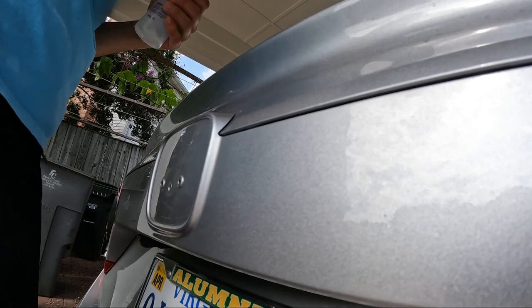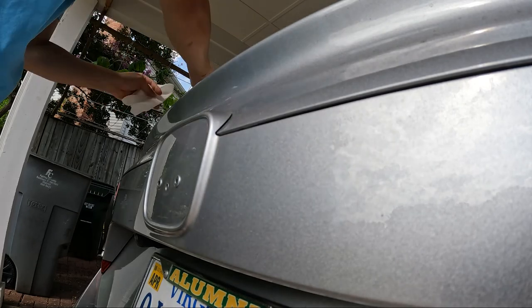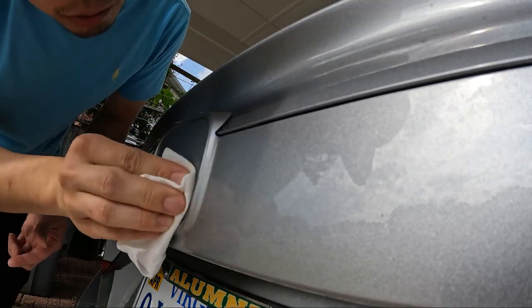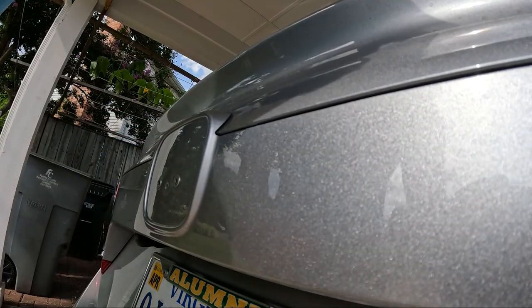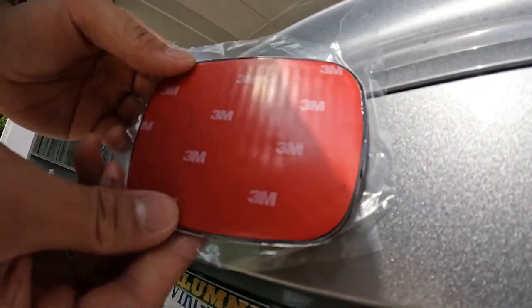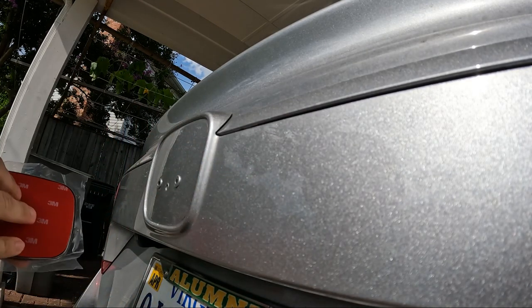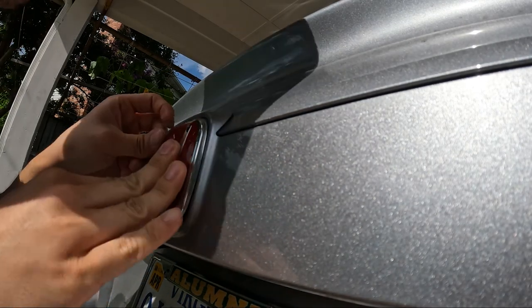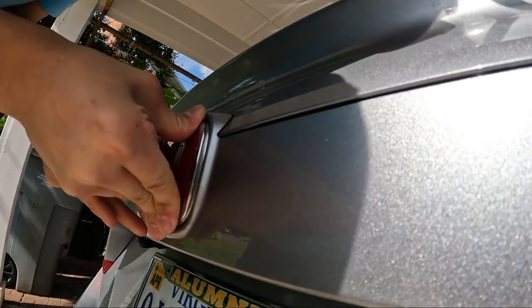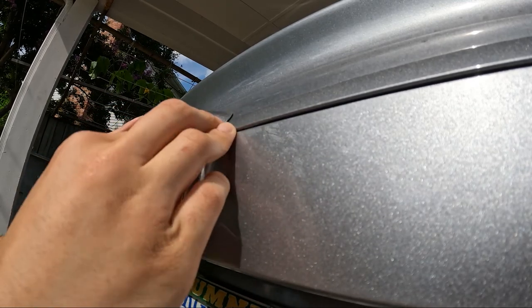With the rears, what you'll want to do is clean the mating surface with some isopropyl alcohol — make sure it's all nice and clean. Once you've prepped the rear, you'll see that these come with some 3M tape on the back. Before putting it on, just line it up and make sure it actually fits the size of the hole. Now that we've confirmed it, peel off the backing, get it in a good spot, press down, and apply pressure for about 30 seconds. And there you go — you have an emblem on the back of your car.